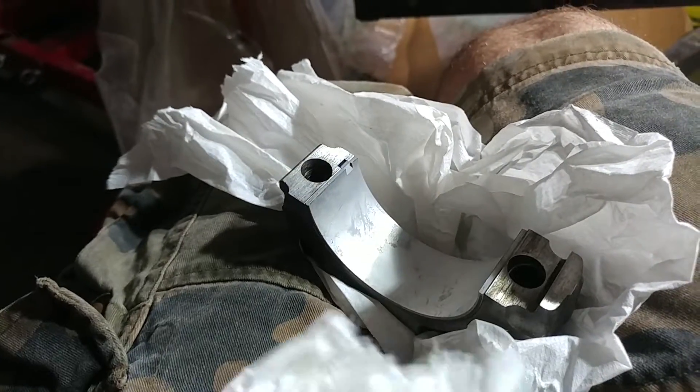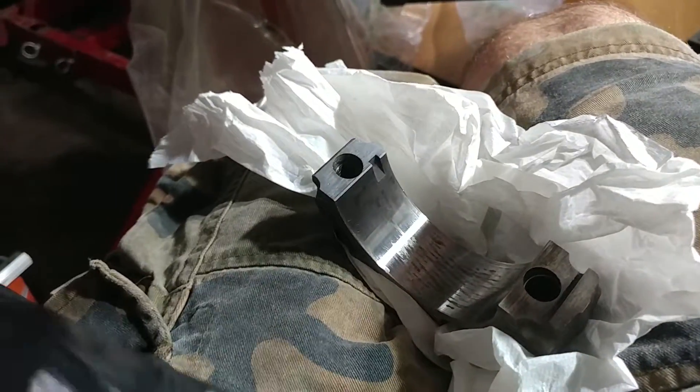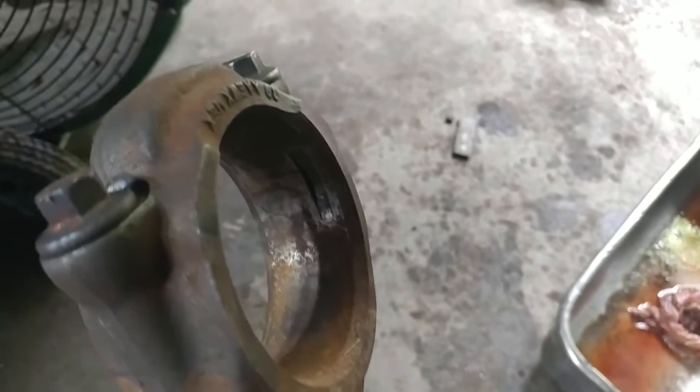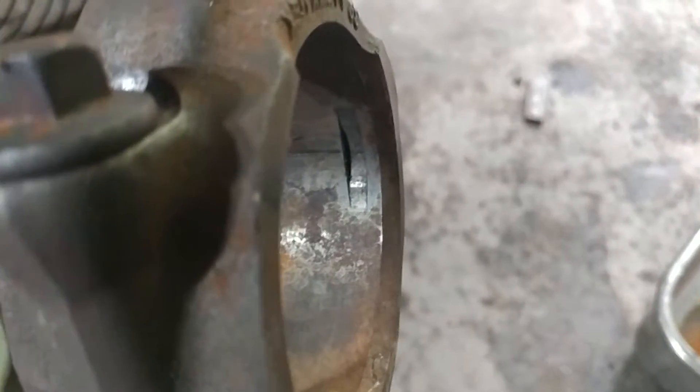I'm going to oil these guys back up so they don't get damaged. There's certainly no reason why we can't use them in a different build — that's standard. Just to show you again: I happen to have a fractured cap here, off of a number five truck. You can see there that the tangs on a common rail connecting rod cap and rod are on the same side, whereas on a 12-valve the tang would be about where that shadow is — on the opposite side.